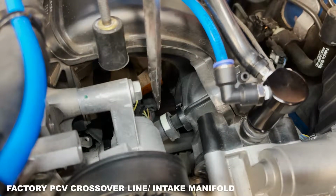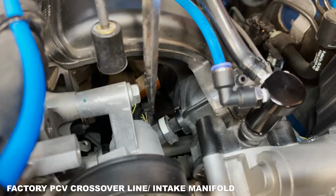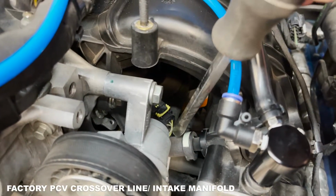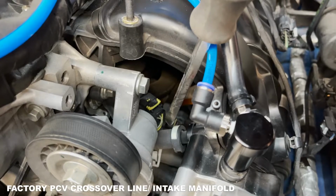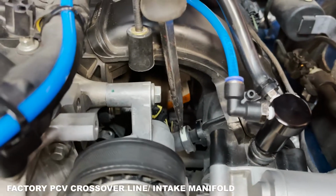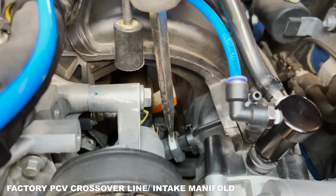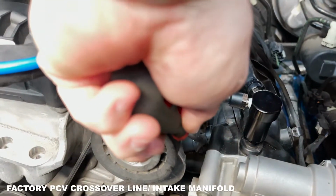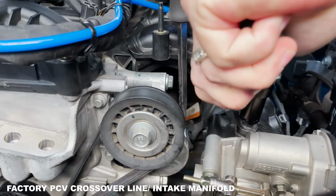Okay, so your PCV connection here at the intake manifold, it has a single large white clip. You do need to take into consideration the location of your sensor here to your fuel rail pressure sensor. Do not damage these three lines or your vehicle will not start. So make sure to take care of that. All we're working with here is a large flathead screwdriver. Our goal is to depress this white clip, and we want to do so in a manner that allows me to then come in behind it, and I use my trim removal tool to, once it's depressed, try and slide that feller off. And now she should be fully clear, fully free for me to remove